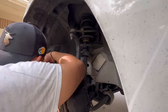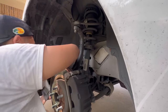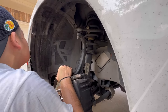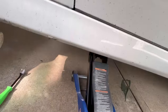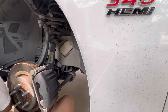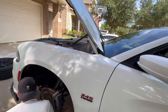We're going for the bolts — 14 of these push pins total. It's easier if you use one of those trim tools. We have it jacked up on both sides. Watched a couple other YouTube videos and they were saying it's easier to leave it on the jack when you remove the bumper and stuff.